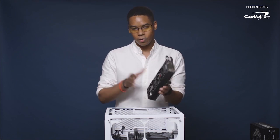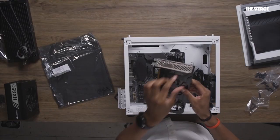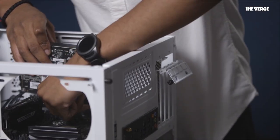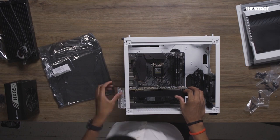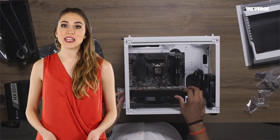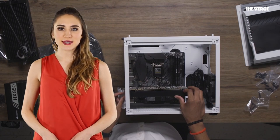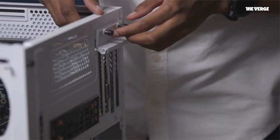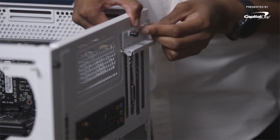Step four, we're going to install the graphics card. I chose PNY's GTX 1080, which is overclocked. You're just going to find the gold connectors and line the bracket with the back end bracket of your PC case. Which lane you choose depends entirely on what other parts you're going to put in the system — I'm just going to pick the top one because the SSD is at the bottom and I don't want to cover it. Check your motherboard manual: not all PCIe slots are the same. Just because it's a full lane slot doesn't mean it'll run at 16x — there are only so many PCIe lanes to the CPU, so motherboard manufacturers will lower the speeds on other slots to 8x or even 4x. Click down, take your remaining brackets and put them in the spots that you haven't used — they get bolted down by the back end bracket, and your GPU is installed.